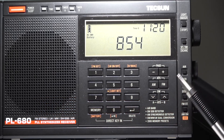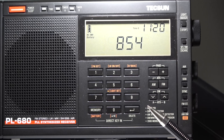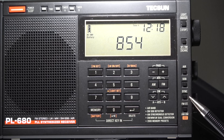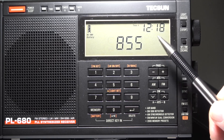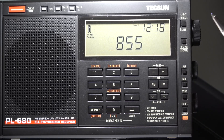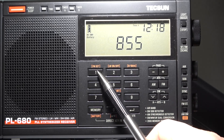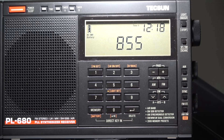So let's start off with the FM band. You would go to FM and tune to the station that you know is off frequency. Then you would press and hold the sync button until the backlit display starts flashing on and off rapidly. At that point, you would use the tuning knob to correctly tune in the station. Once you're satisfied that it is correctly tuned, you will press the number one button and it will confirm that the station's been locked in. At that point, your FM has been calibrated.